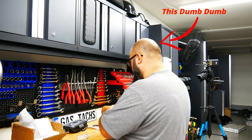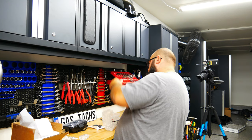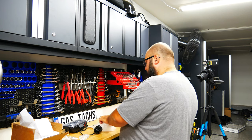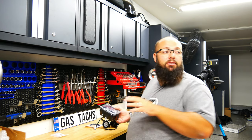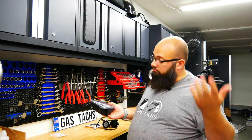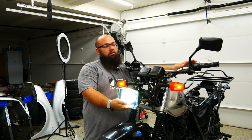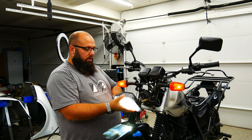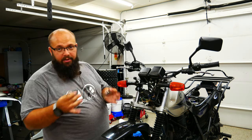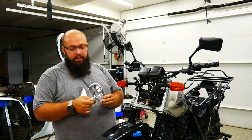Let me get the products we're actually gonna be installing today, put them here and go over what the game plan is. There's a link down below for all the products I use in my videos, so if you like anything you see here be sure to check those out. Before installing the headlight completely, I'm just gonna plug it in, turn the bike on, and see if it works — because you always want to check that. Simple plug and play, light is on, brights are on. Wonderful. Everything I got is specific for the TW. You can buy generic headlights and generic mounts but a lot more finagling is needed.